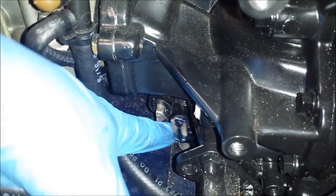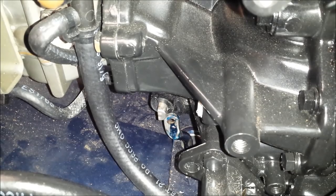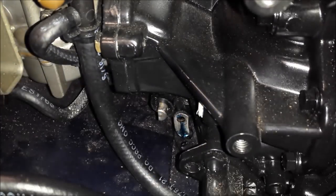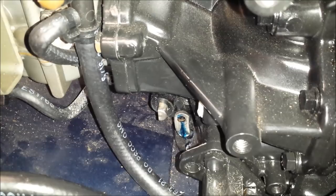Okay, the shift rod should be where we need to be. I put some grease on the lower grommet. Now I'm going to try to force this grommet on with the rod installed, because it honestly didn't feel like it was going to happen with the traditional method. I'll deal with it in a sec — no reason to record you watching me fight with that thing for an hour.